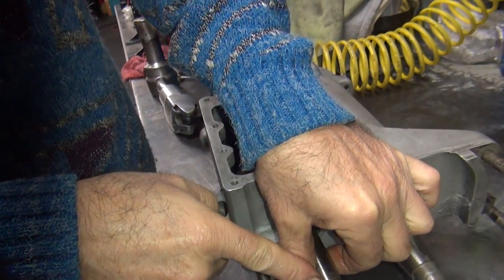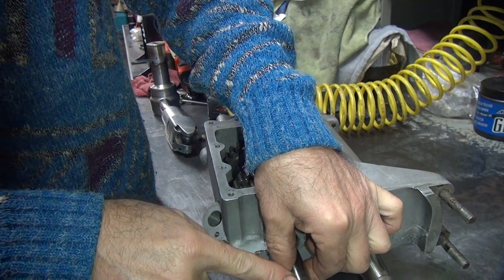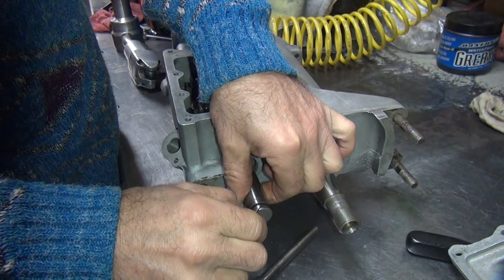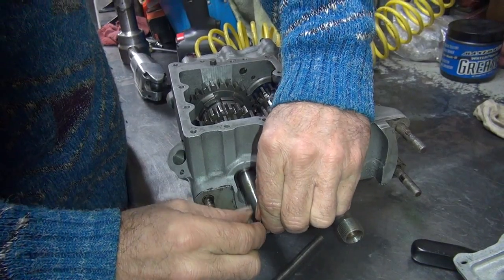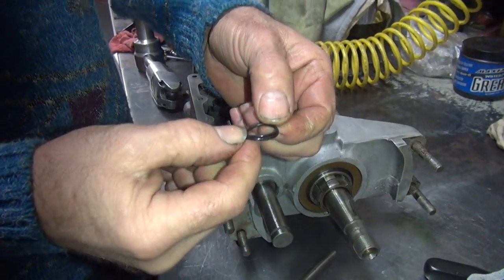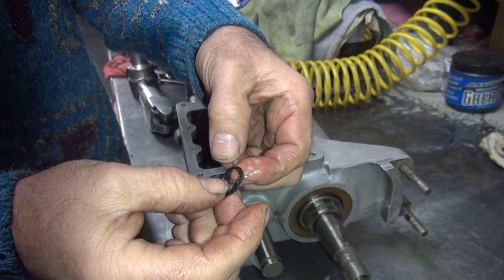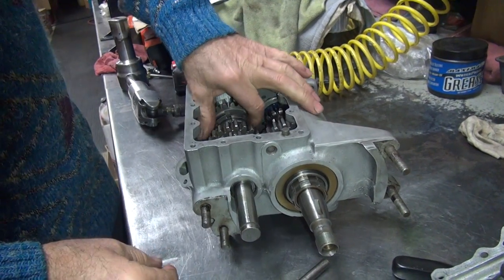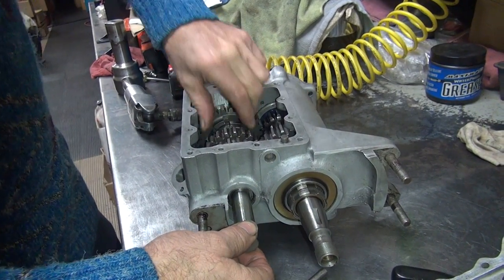Sure that wouldn't have leaked any. Nah. It's just a little excess on the O-ring. It needs to be trimmed. Yeah, well, it's flat now. So my guess is this tranny was going to leak. So this O-ring is in need of repair. We'll just replace it. I'm trying to fix it. We're not going to repair it? No. Get a little glue in there? We can't glue that back together and make it work again? Yeah, if we had to, we probably could, but we're not going to. Humpty Dumpty broke. Okay, now there's a washer up in here we got to get out once you pull this out.